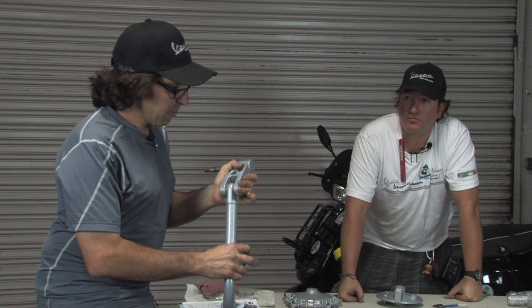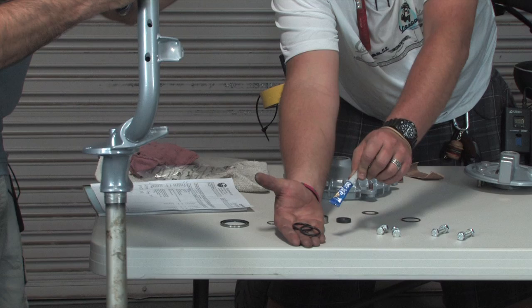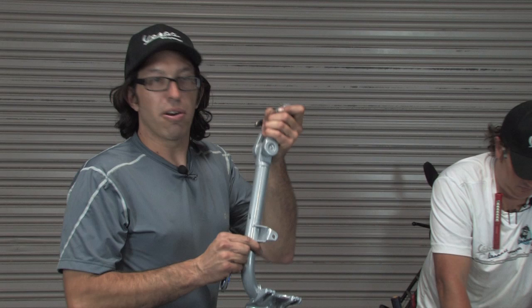One little trick we're going to do, since I cut the O-rings out: I'm actually going to slice them with a razor blade to make them about the same diameter, then superglue the O-ring ends back together. You pack a little bit of grease in there and use your fingers or two needle-nose pliers to hold the O-ring ends together while the superglue sets. That will suffice to keep the dust and moisture out of these bearings — a simple thing to do if you're getting this powder coated with the bearings already in.